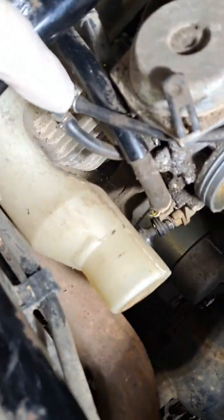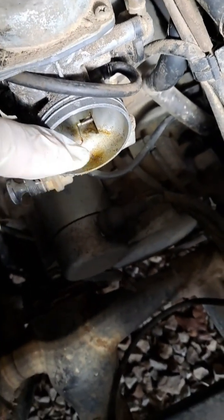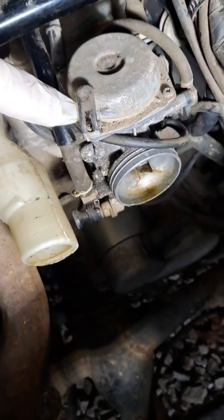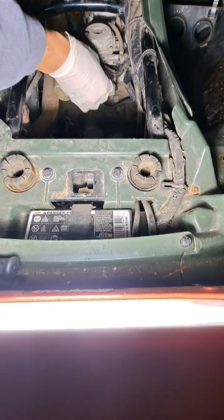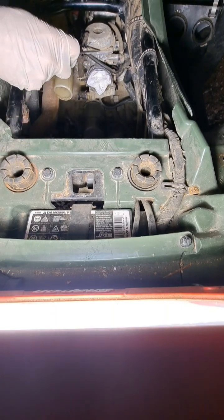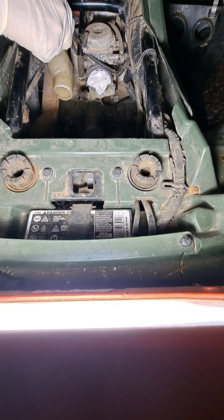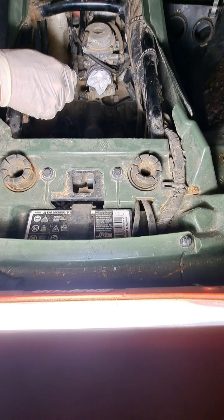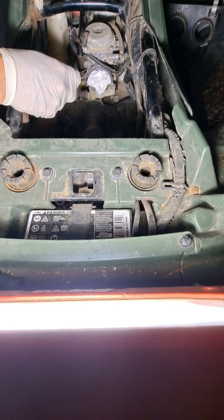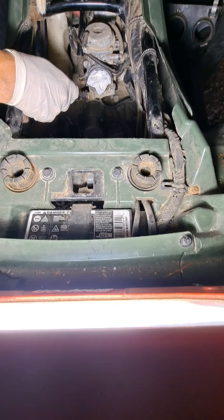All right. And now that I have the vacuum line correctly installed with a shorter hose, I'm going to go ahead and clean this debris off of here. I'm going to block this up so nothing can get in there. I'm just using a hook tool here to kind of loosen this debris. If you have a vacuum cleaner, that may be very useful. But I have this paintbrush that I can just rinse out. Some of this stuff is pretty loose, and when I'm testing it out, I don't want it to be ingested in there, and it needs to be cleaned anyway.